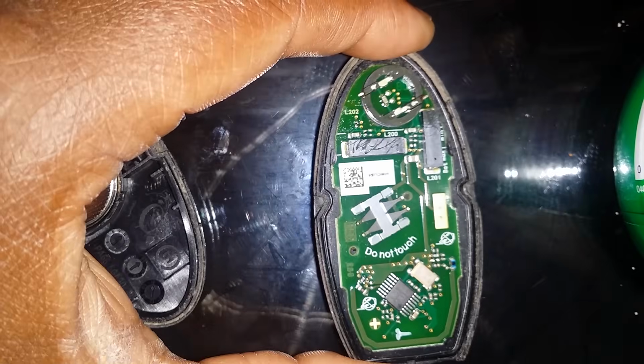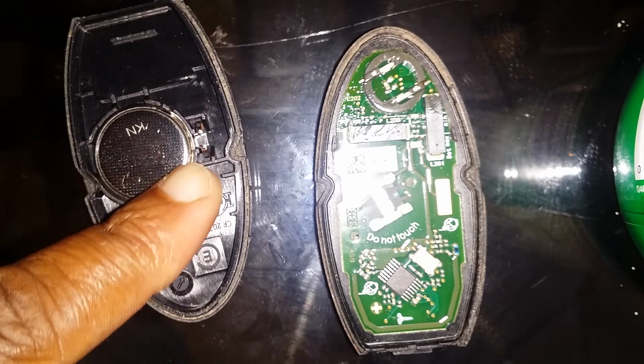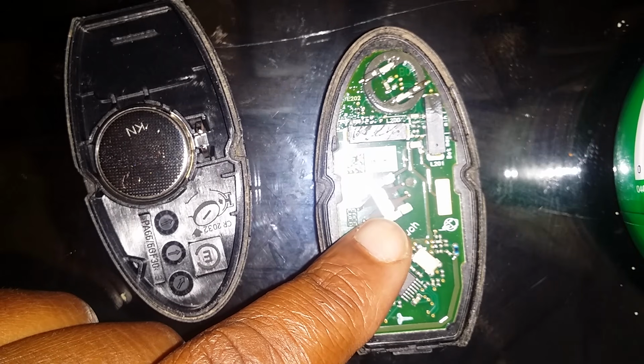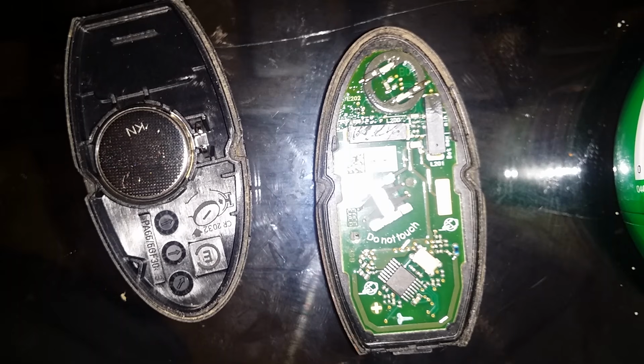So all I'm saying is, before you take it to your dealer, please open it up and see if there's something that does not look correct. If one of these prongs, being the 2 prongs beside the battery, or the 4 that actually touch the battery completely when it is closed, are bent, try to fix it yourself gently. If you do end up breaking it, you will have to pay that $200+, which is just the new fob, battery, and the labor for them to do it.